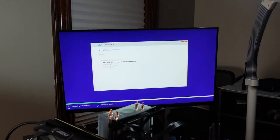Install in there. All right, so this picked it up, but that happens whether it's the modified BIOS or not. The issue will be if it tries to boot without the modified BIOS, it can't boot from a PCI Express drive. I like using the PCI Express drive, because then I don't have a SATA cable and a power cable. It's all self-contained and doesn't take up much room. It's even nicer in modern computers, where you can just install it on the motherboard. All right, so we got the files. So it's going to restart.